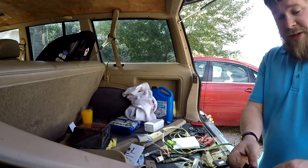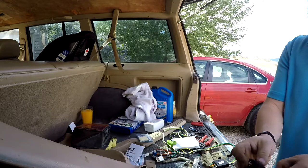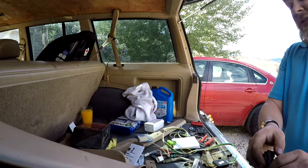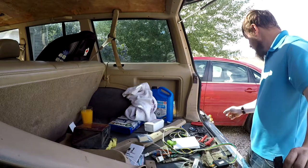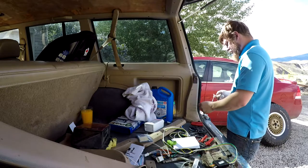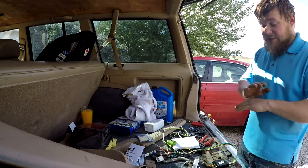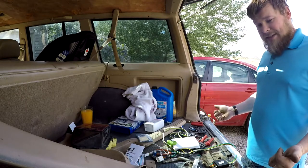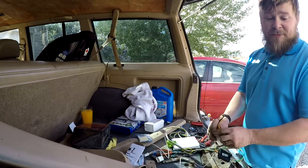So we know what color it is. So we know double white is our brake lights. So we have a single white here. And actually I should test that, because we know this side has a white, but since they're now all separate... No, that's stupid. Oh, I'm an idiot, I'm sorry. I had a brain fart there for a second thinking, do I have to tie in both brake lights together? You do not. I keep forgetting about that. So I just gotta tie in the one brake light, which I know is single white here.